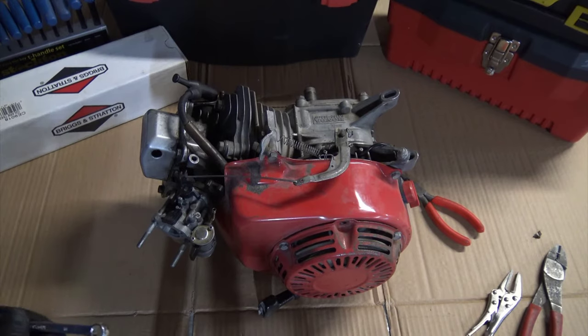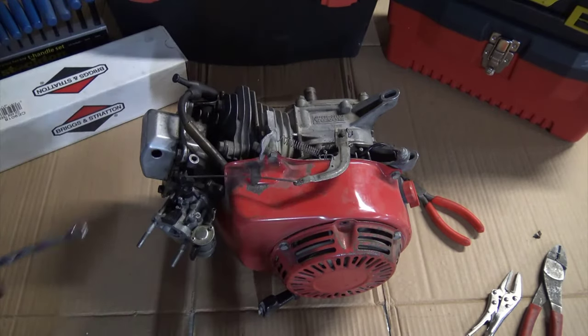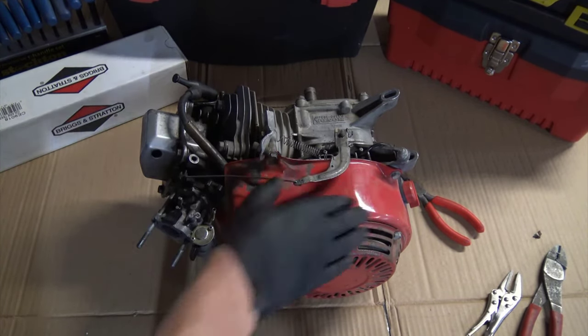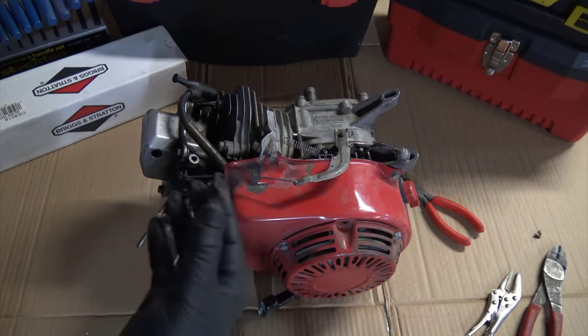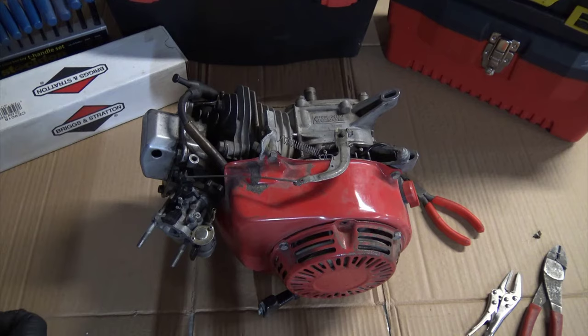The static adjustment is getting the parts on the inside of the engine up next to each other, where they can mechanically work together in unison to sense the speed and close the throttle and keep it from overspeeding. When the engine speed drops, the spring would then allow the throttle to be opened against the loss in pressure from the flyweights on the inside of the engine.